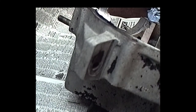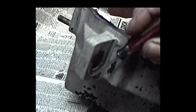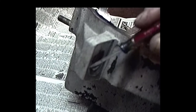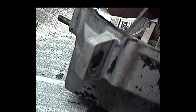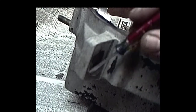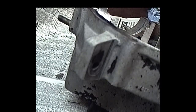One thing that sort of bothers me about these crankcases is, I don't know if you can see it real good, but where this bottom motor mount is, there's a definite recess in there where the thing was sitting on the frame mount, which indicates to me that this thing was vibrating like a bitch and probably loosened up. Now I got to check out all the particulars.